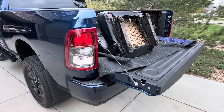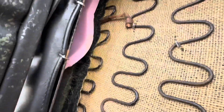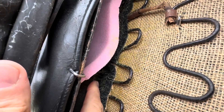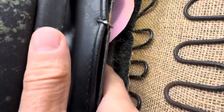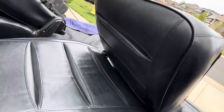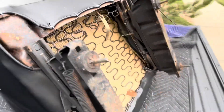I wanted to show a closer look at what was done to the seats at the interior shop. It has new burlap, and he also added a layer of jute, then a one-inch thick black foam, and then the pink material underneath that. So it goes: pink material, then the one-inch foam, then the jute. He then shaves down the foam to fit the actual contour of the seat itself, so it's a custom-made fit.